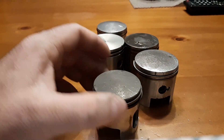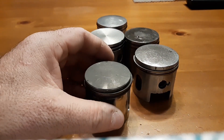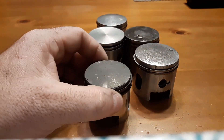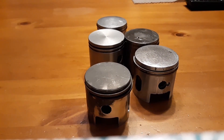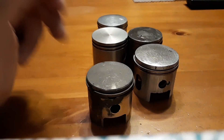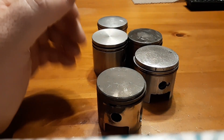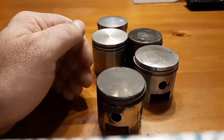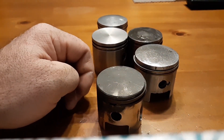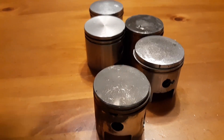The 32 to 1 is designed for organic oil in these engines, and 40 to 1 is for synthetic oil, which covers roughly the same range. Oil plays a huge role in compression — if you don't have enough oil, you're losing compression, not lubricating properly, and the engine runs hot. That's 99% of the reason people are having overheating problems.